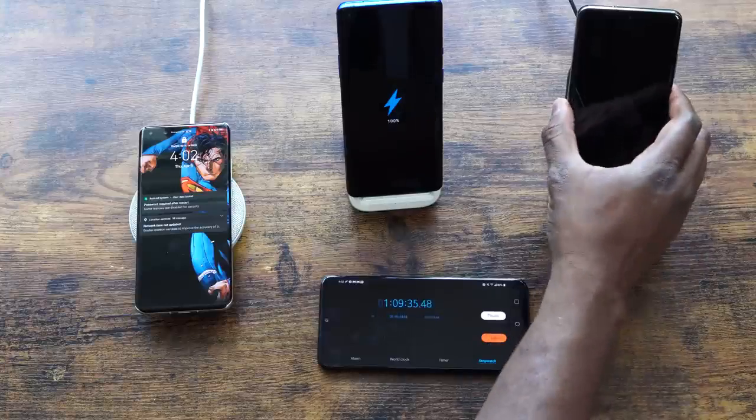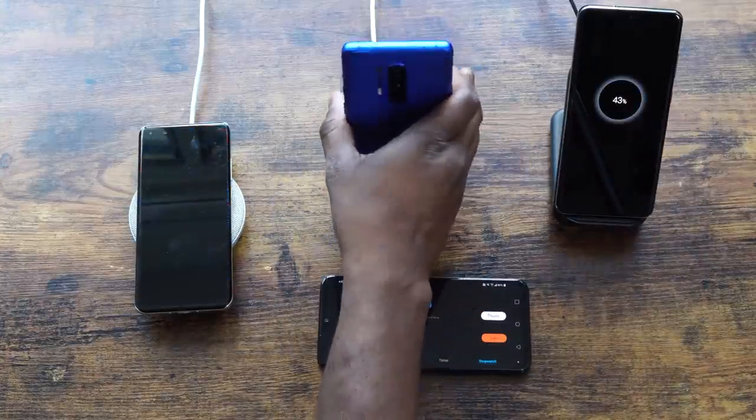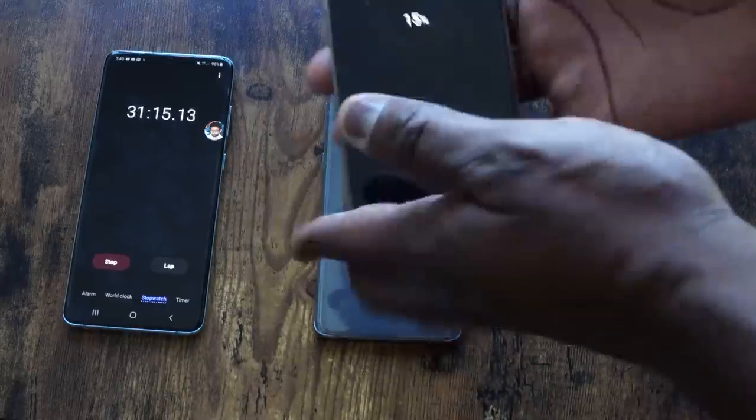Overall, this is showing something pretty interesting about wireless charging. For the longest time people dismissed wireless and reverse wireless charging, but we've got a wireless charger from OnePlus that charges in an hour and nine minutes — faster than any iPhone would ever charge and faster than what Samsung does wirelessly depending on the charger. We've also got reverse wireless charging that gives a 3100 milliamp device 15% in 30 minutes, which is still better than some phones and some chargers — some iPhones still come with a 5-watt charging block, and iPhones don't even wireless-charge at that speed.